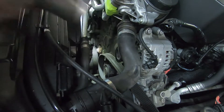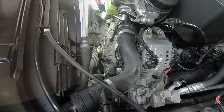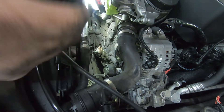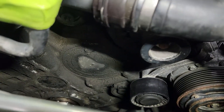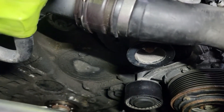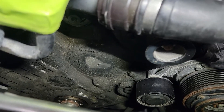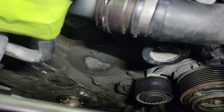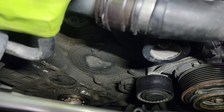The tensioner is brand new — I just bought it last year. It's also a good time to check the belt. After taking out the harmonic balancer, the area is full of grease and oil, so I think it's a good idea to clean it before we install the seal guard and the crank bolt capture. I'm going to use a microfiber with brake cleaner to clean it up.